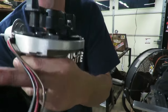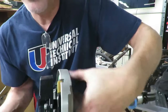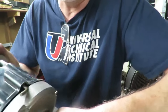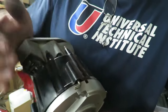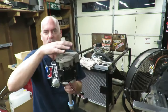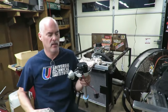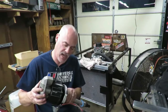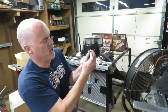Right next to the mounting clamp there is a small square dowel that fits right into a matching slot. When you slide it over and line up with that square dowel, the cap pops down and locks in — that's what locates the cap. So the cap goes on only one way. What I need to make sure is that after the cap is on, when I get the distributor in the engine, this rotor is pointing to my number one spark plug wire. So I'm going to put the cap on, line up my dowel, and mark number one right there.